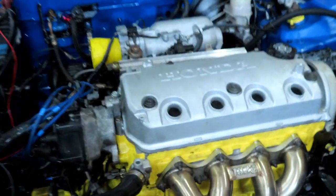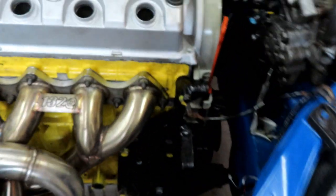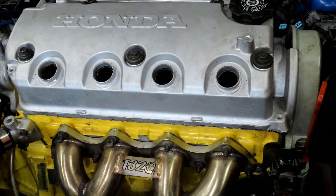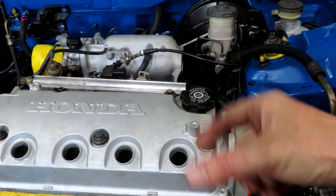You can see this head from the last video — it's already on. The injectors were not firing literally at all. We also found that the oil pump, when we had the head on and were turning it over, no oil was coming up to the top of the head. I had a good amount of assembly lube in there, so it wasn't that bad. We went ahead and dropped the oil pan and the oil receiver — the bolts for it were just loose.